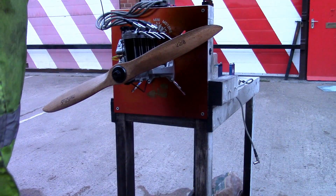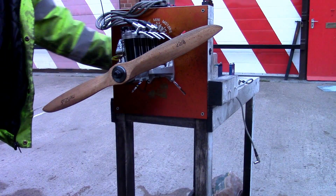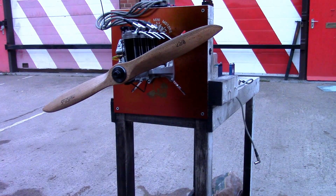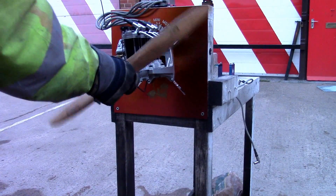The engine is running a 22 by 8 prop and runs really smoothly, starts easy. It's brand new so I'm taking my time with it — it's not mine, so I'm not going to run it too hard. Idle is about 800 RPM, very low idle, no vibration at all. Top RPM I'm seeing at the moment is 5,500 but I'm taking it easy. This kit is already available on my website, Morris Mini Motors — click on the conversion OS and scroll down to the bottom.